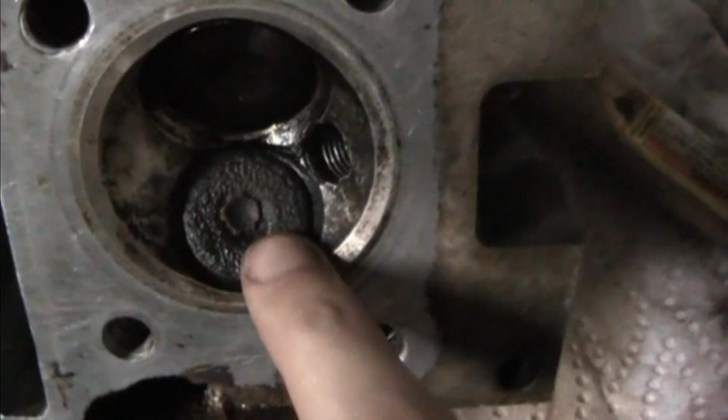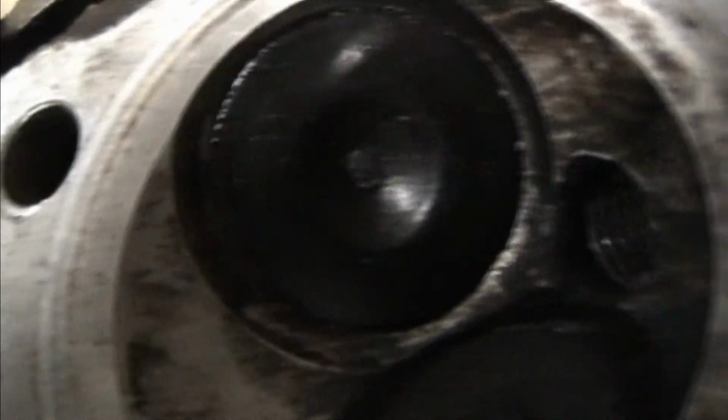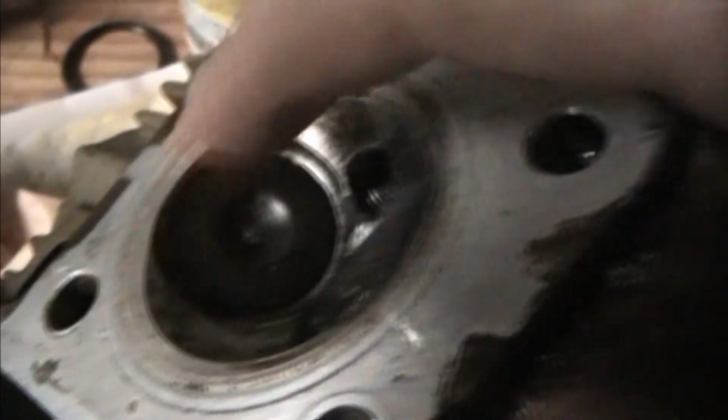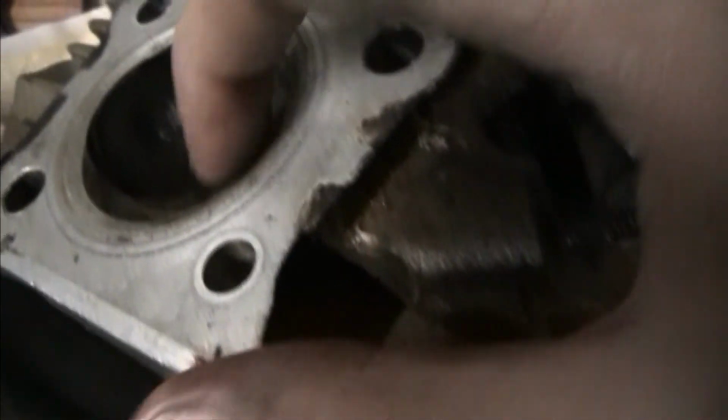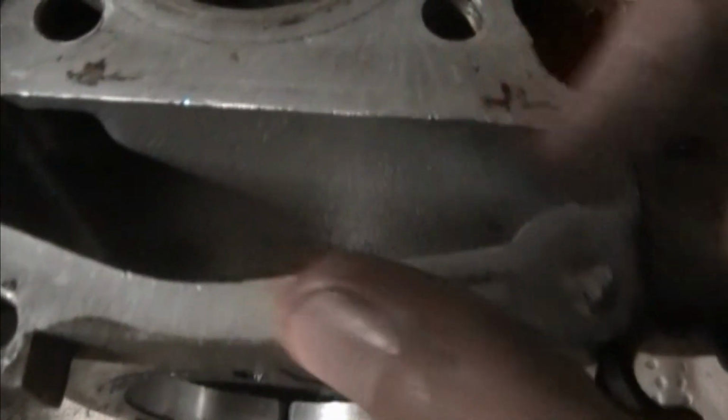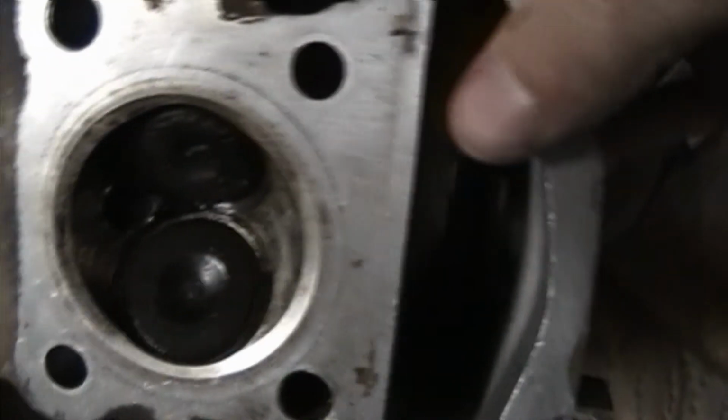But anyways, this exhaust valve is just different. I mean, look at it compared to the intake valve. There's your problem. Anyways, I looked at the intake valve too, and it seats real nice. It's all shiny metal where it seats. There's no rust on it. This one, there is rust. How can you get rust in an oil-coated engine? It's been sitting for a while, apparently. So anyways, new valve, possibly new valve seat, possibly new valve seal,